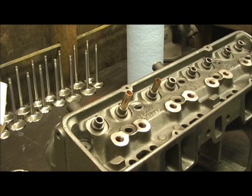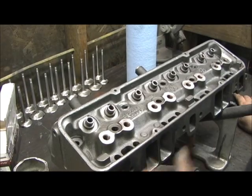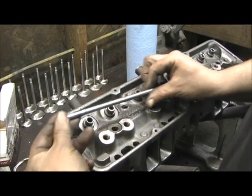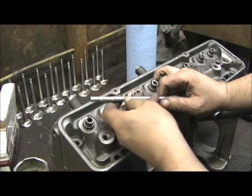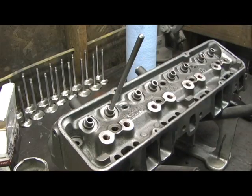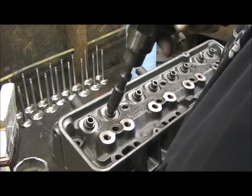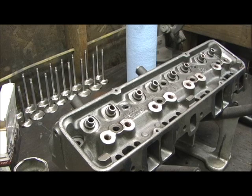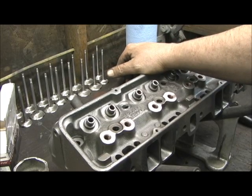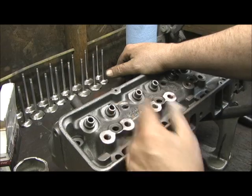The installation is the easy part; the hard part is when you have to hone and size them. For compression I go to the tightest broach — a steel shaft called a broach with two enlarged radius areas. It goes in and compresses the guide against the wall, giving it a squish. These are sized to half-thousandths under the valve size for good compression. Once done, I let it sit for a while to let the red Loctite dry before I go in with my hand hone.